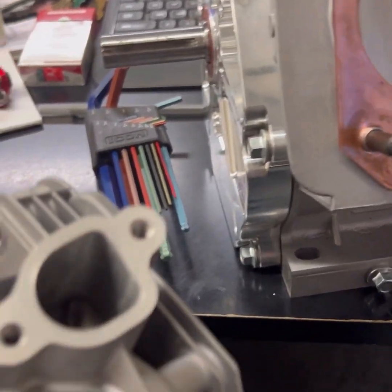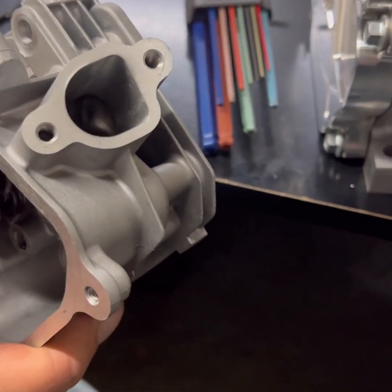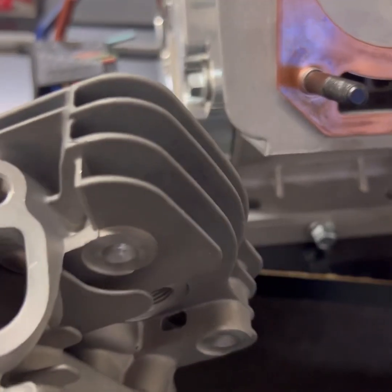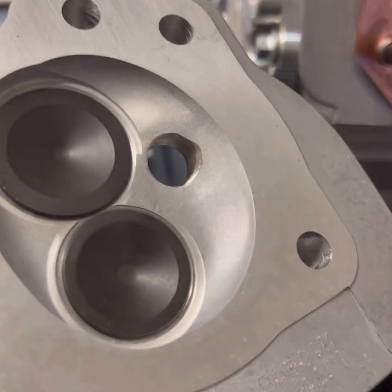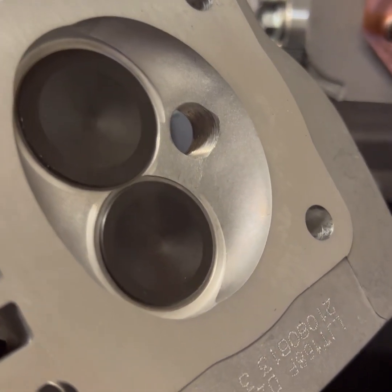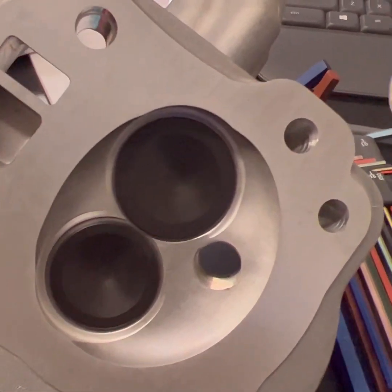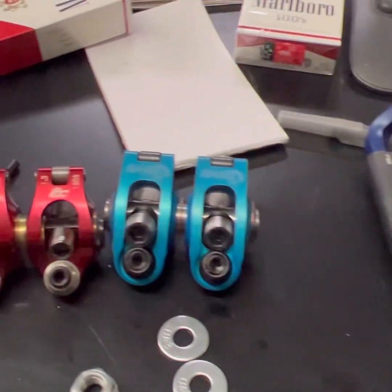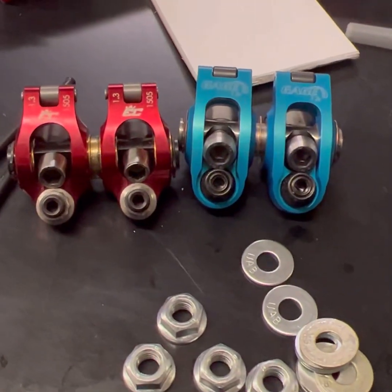Only because we don't get any piston-to-valve clearance with this head. Now we've got a little better light in here today. This is a beauty of a cylinder head — they did a damn nice job on this thing. The chamber's a little small, so it's going to have some squeeze and some pop. But we don't have hardly any piston-to-valve clearance. So what we're going to have to do is step down to a smaller cam, change some stuff around, and use our other crankcases to build up that MoFlo deal.